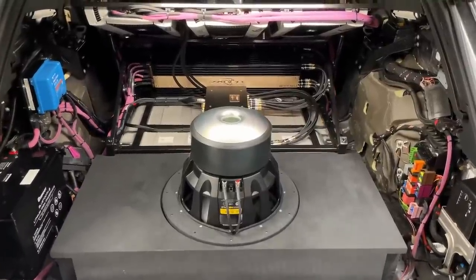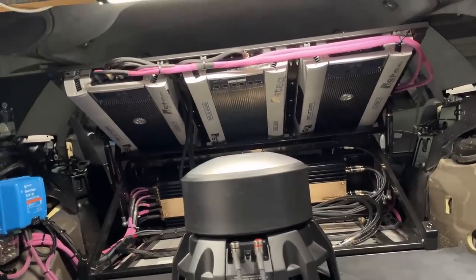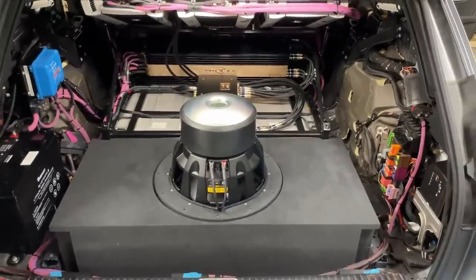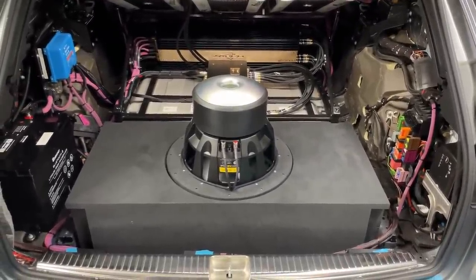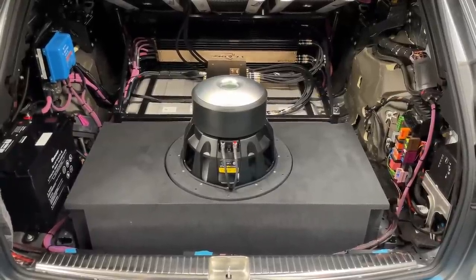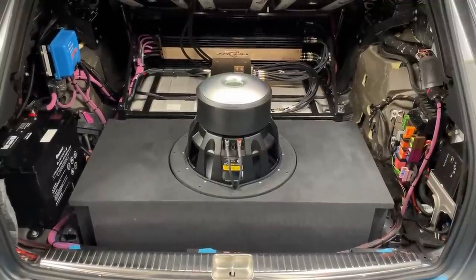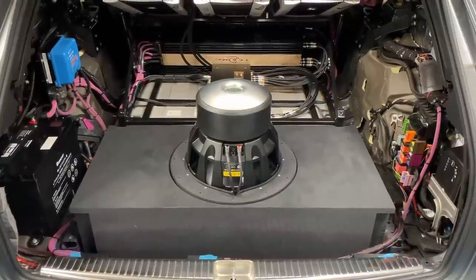And we have also fitted hybrid audio L2SEs that we had from the Insignia up there, over there, that I can't show now, but you can see the picture, how we mounted them in the factory mounting bracket. For that we had to sacrifice a factory speaker, but then hey-ho, it would have ended up in the bin anyway. So we just modified the factory bracket of the speaker, 3D printed a mounting ring, bolted the drivers in, and they went straight back in to the factory location.